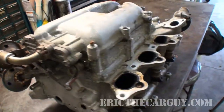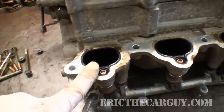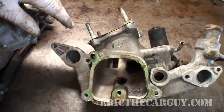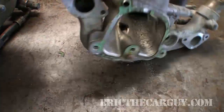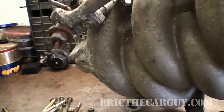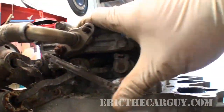Let's start with an overview of this intake. It's actually turned upside down right now because I had to remove the fasteners to take this thing apart. But these are where the intake manifold terminates. This is the throttle body up here — the throttle body is attached to this part of it. I've just removed this part. The throttle body would be attached to this, going into here and then into here. As you can see, it splits apart and goes through these long, narrow runners.